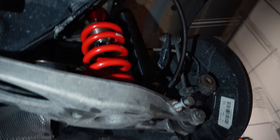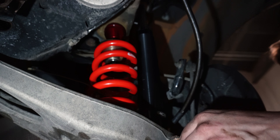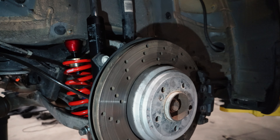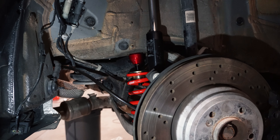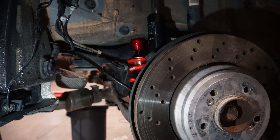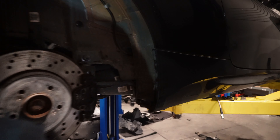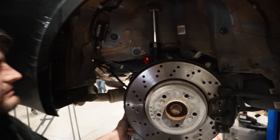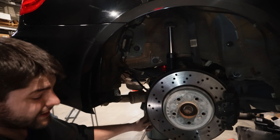Look at that - love taps, nice, helps itself stay in there. This is great because it has the adjuster at the bottom so you can easily do ride height even when the spring's in it. We did buy helpers but we didn't end up needing them - we went through all the suspension travel and it just wasn't needed. Easy money - save the 50 to 60 bucks a corner.